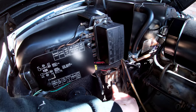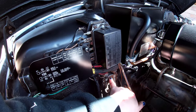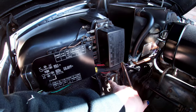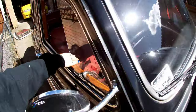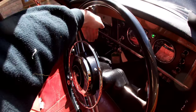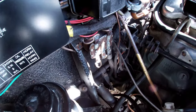With the ignition on you'll get 12 volts here - battery voltage, whatever your battery voltage is. Once you've engaged overdrive, I'll show you now. I've got the car in fourth gear, ignition on, overdrive down, and then go around here - if I get you close to the relay you should hear it click.